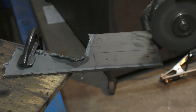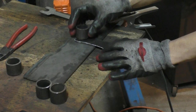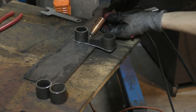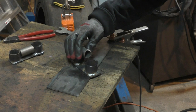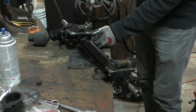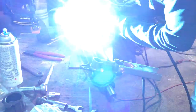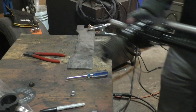For making the brackets I started off by cutting some sheet metal, then drilled holes in it and attached tubes at the back to reinforce the bolting points. After that I welded a tube in the middle to further reinforce the mounts. Once all that was done I bolted the mounts to the steering rack and welded a tube in the middle going from one mount to the other. Then it was time to put the steering rack in its proper place so the rest of the tubes could be welded to it.